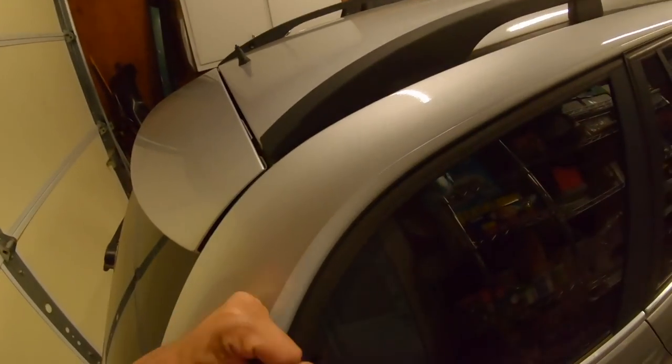Hey guys, I'm Joel. In this video I'm working on the E46 budget wagon. You guys were 100% right in the last video — just change the O2 sensors, get them replaced, because that is the fix. I got so tunnel-visioned because I kept hearing people say tune the ECU and delete the rear O2s, but that's not how you actually pass emissions — it just makes the light go away.